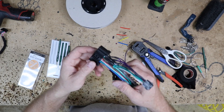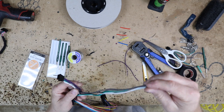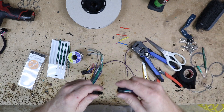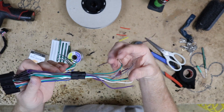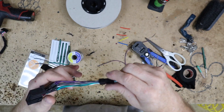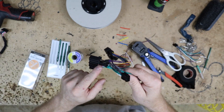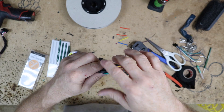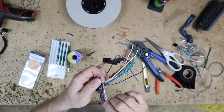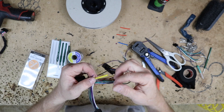I really don't want to cut into all these to remove this off of here. At first I was going to use these, but now that I've removed this and see that this actually plugs in, this might be a better idea. I can have my wiring from my DM come into this and not have to do any soldering behind the dash. So that's really appealing. But I don't want to cut into all this and then have to put tape or shrink wrap. I'm just going to leave this. What I'm going to do is cut these ends short and just put shrink wrap over the ends so that these don't touch.